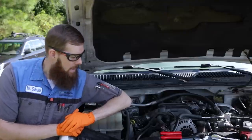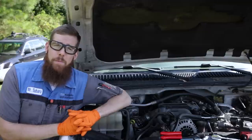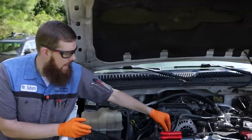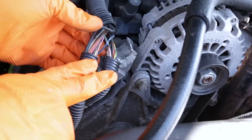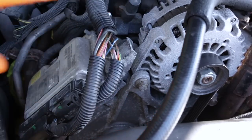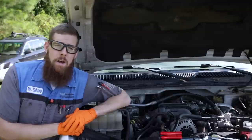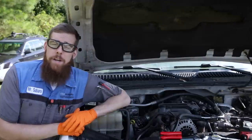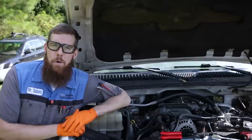That's a little shortcut to get there. Now, if you had the plugs disconnected and turned the key on and your fuse still blew, I would look at the wiring next. Likely you have a chafed wire — one of those two power wires is chafed and shorting to ground, pulling too much amperage and blowing the fuse. If you look at the bracket beside your alternator, that is a very notorious spot for the wiring harness to chafe and break or skin wires enough to short to ground. Check there first. In my case, I already had and resolved that issue — I fixed the broken wires, soldered in replacements, covered it in heat shrink, taped it up, and put a piece of serpentine belt between the metal bracket and the wiring loom as an insulator, then zip-tied it tightly so there would be no more chafing.